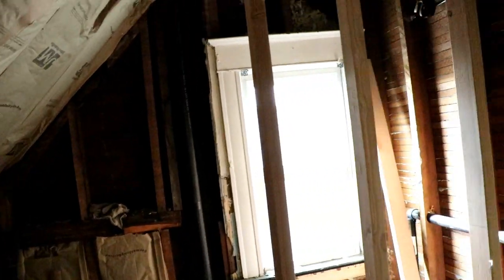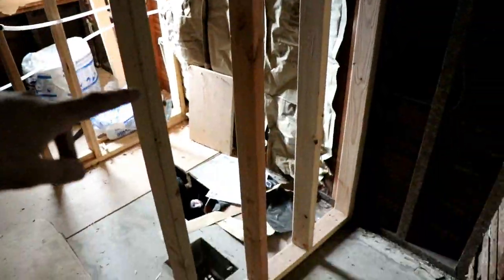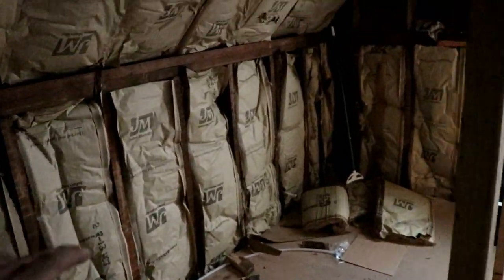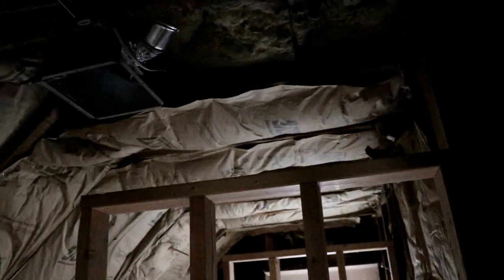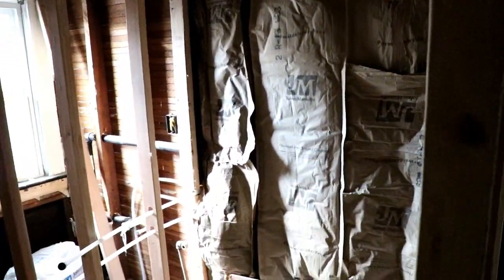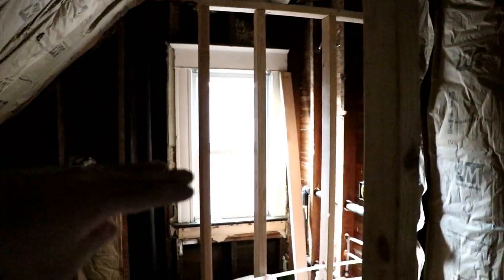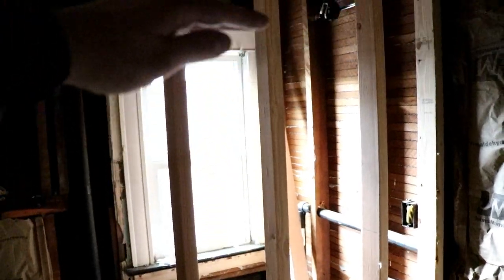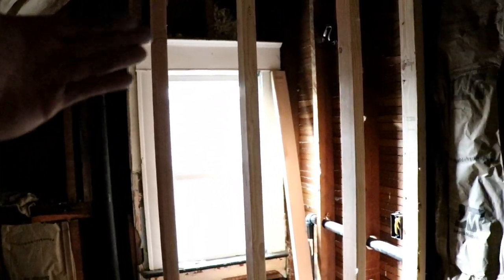Insulation on this wall. This wall's gonna get torn out and moved back for the tub to go in there. This floor vent window getting moved over. Cabinets here. Half wall here with the toilet right here. And then all drywall, ceiling, walls, tile floor. And I will also be tiling the tub surround around the tub here from the floor to the ceiling. And I'm pretty sure right here, up to 3 feet, there'll be a wall of tile, and then it'll be glass blocks to the ceiling there to allow natural light to come in, but also some privacy for the person in the tub.